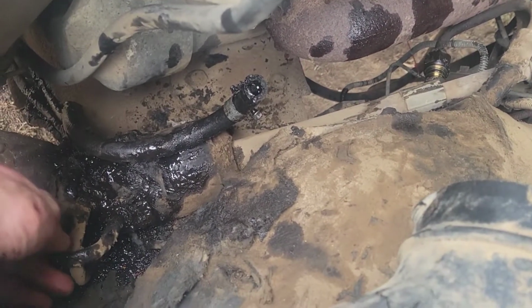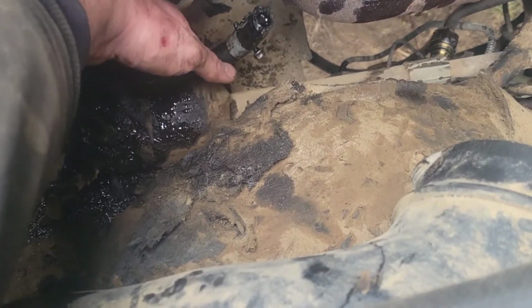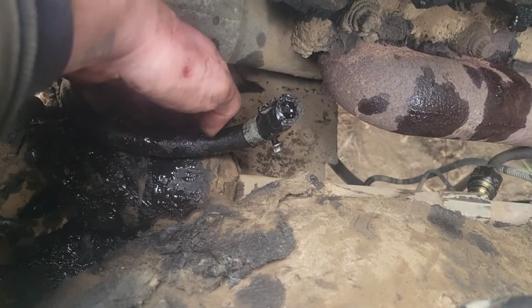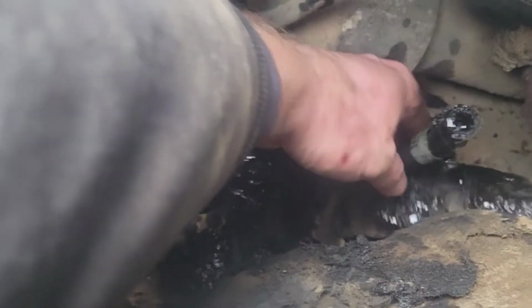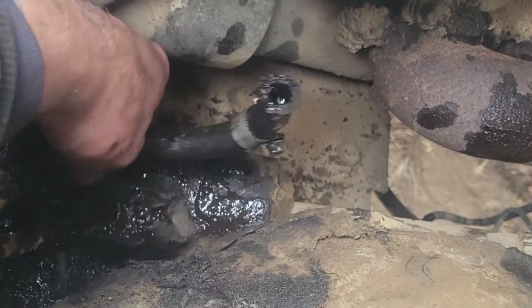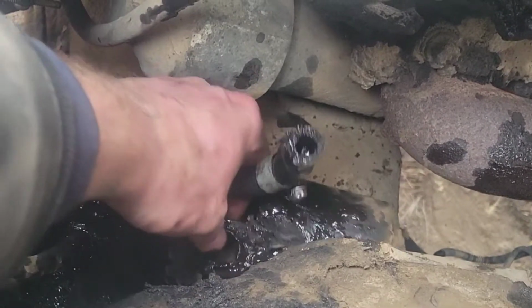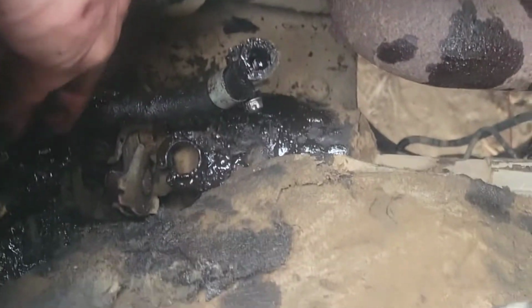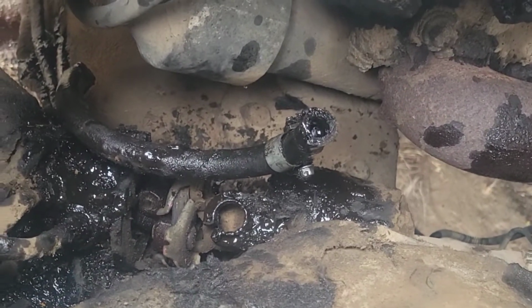But then also you've got this plastic housing here. I don't know if you guys can see that. That goes over one of the lines. I figured out that that end that goes around the line has a break in it, or an opening. So you just pop that out and around. Now that plastic piece that protects your rag joint slides up.